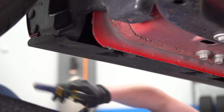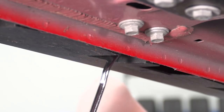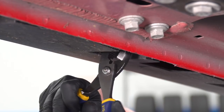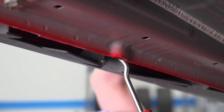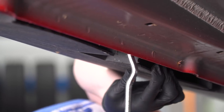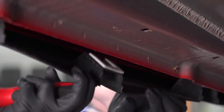At this point I'm gonna switch over to a pair of pliers because the end of the pry tool is getting beat up, so I'll grab the pin with the pliers and pull it out. A little trick you may want to try: slide the tool up under the factory rocker panel and pull the clip out of the body prior to removing it from the rocker panel. As you start to remove more clips, it'll become easier and easier to pull down on the factory rocker panel.